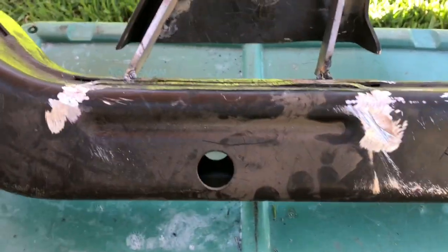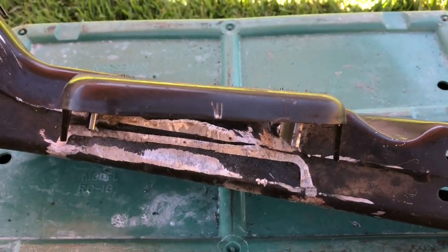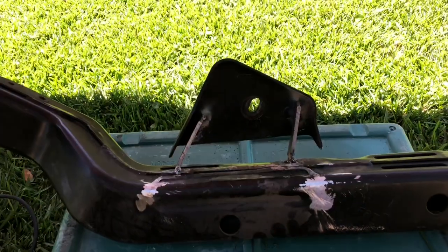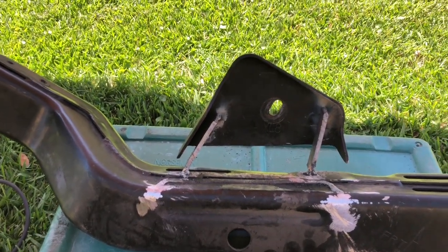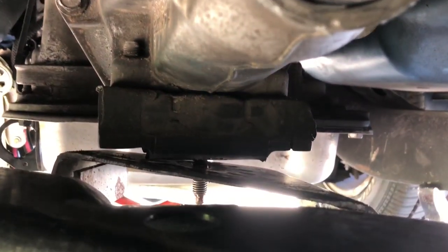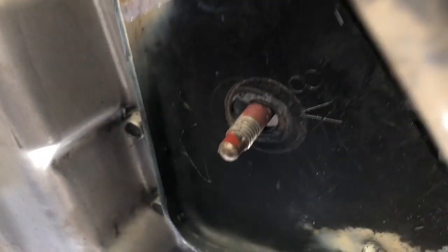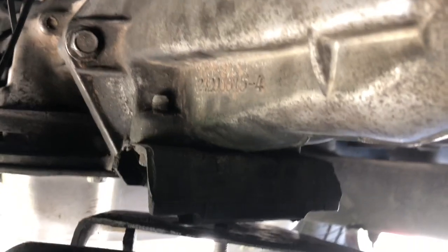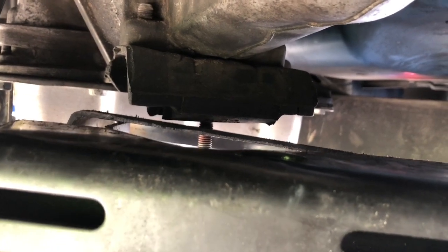I determined it was an inch gap that needed to be right here, so I put in my inch gap and put a couple of tack welds in. What I'm going to do at this point is go ahead and test fit it in the truck, see what we've got, make sure it's in the right position before I go ahead and weld everything else up. Because the last thing I want to do is get this thing all welded up and find out it's not correct. Do you see how I had that little offset like it was welded from the factory? That's actually messing me up right now. So what I'm going to do is cut this side off and lower it down like the other side, and I think we'll be perfect at that point, because we're lining right up with the bolt hole and we're just about at the right height.